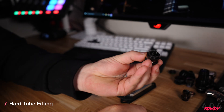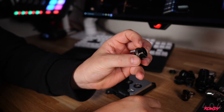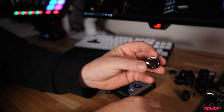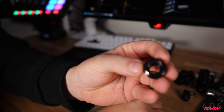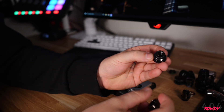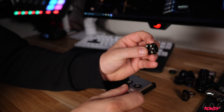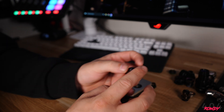If you were to go with a hard line loop, the fitting you would need to purchase would look something similar to this. These are very similar to compression fittings but the application is very different. Within the fitting itself there will be seals — maybe one or two depending on the manufacturer — and then once the tubing is placed inside the fitting you'll have another seal that goes over the top, pulled together with the compression collar. It's a little more complicated with more steps and more things to watch out for, especially the seals, but that is the fitting for hard lining.